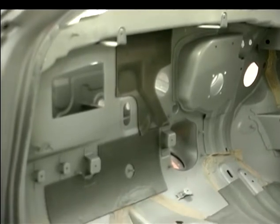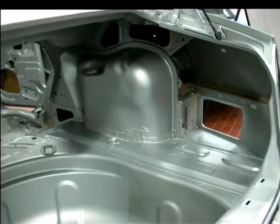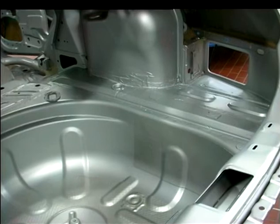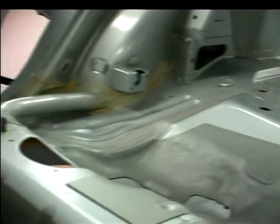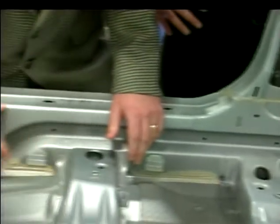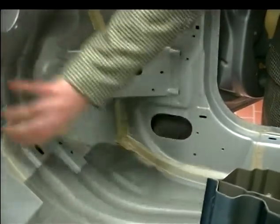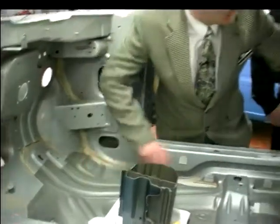Underneath the floor here we have some more sections, slightly smaller, that run from the back to the front of the vehicle. Either side of the spare wheel well we have what we call the rear longitudinals — a box section about 100 millimetres square — which runs underneath and then dives out into the section just underneath the rear door. This section runs along underneath the doors, and as it comes up to the front of the car it dives back into the dash area and forward into the front longitudinals, forming a very stiff underframe on which we can mount the upper structure.